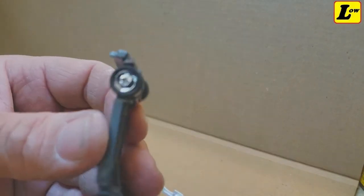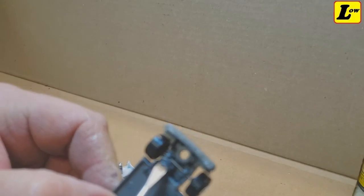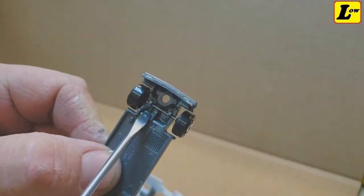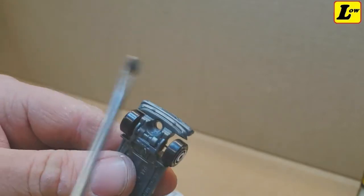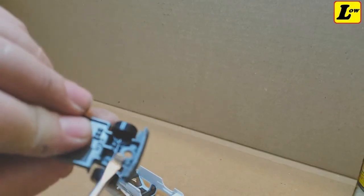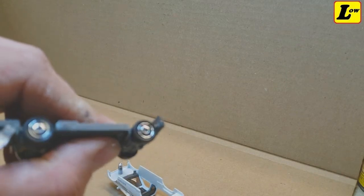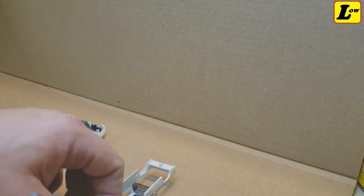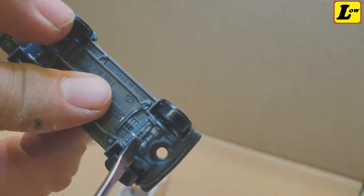And if I'm going to lower this vehicle, I've been thinking about how to do it, due to the fact it's got a four-wheel drive suspension. I'm not going to do it on this one, but I'm going to on another one and drill it out. I'm going to put JB Weld in here, set the axle height where I want it, and this may not look the best in the world. Matter of fact, it won't. Once the JB Weld sets up and solidifies all this together, then I'm going to grind some of this off that I don't want. But on this particular vehicle, I'm going to cut these little nubs right here off that match these nubs right here, where this thing sets together, where it looks like it's a four-wheel drive.